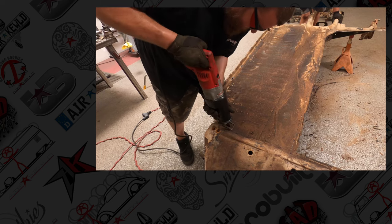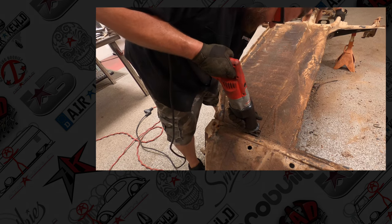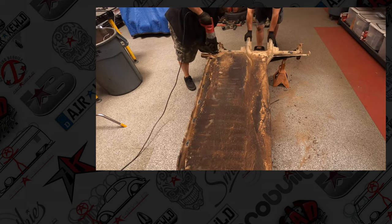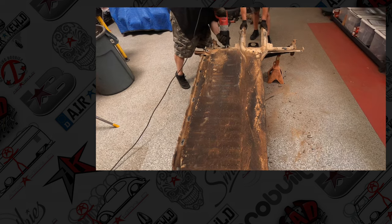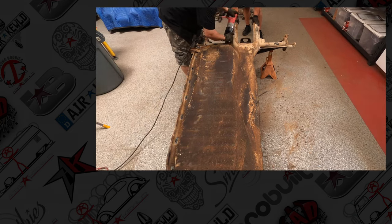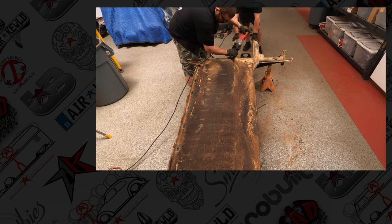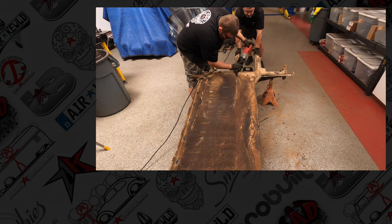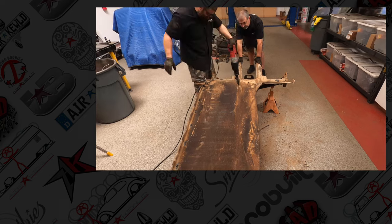We use a company out in Arizona called Express Stripping, and they submerge these tunnels in an ammonia bath. Usually that happens over a week period of time. The water will actually go inside the tunnel through all the tubes, and it'll come back out looking like a brand new chassis. After that process, we have them sandblast it so that everything is ready to go. We'll show that in the next video of us cleaning it up and getting it ready for pan halves.